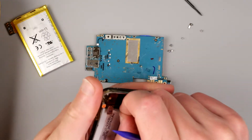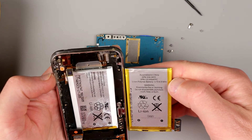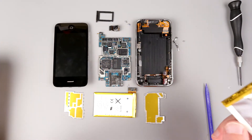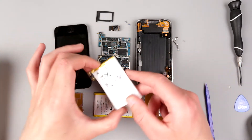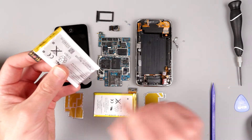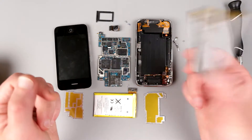Here is the battery, and I think it is glued — it is glued. As you can see, I took everything apart in order to yank this battery out. I had to add a little bit of alcohol, but it didn't help too much. What I also did was turn on my 3D printer, put this part with the battery glued on it, heat it to 85 degrees, and that actually helped a lot to dislodge the glue. So yeah, this battery is completely gone — gonna ditch it.